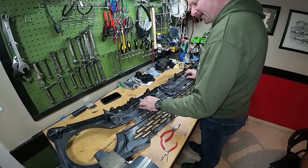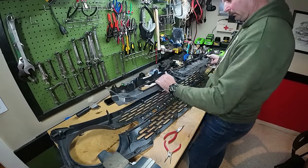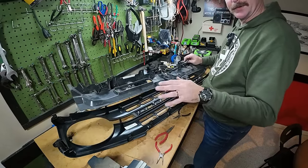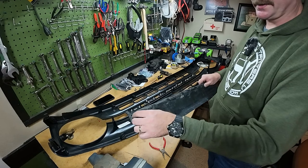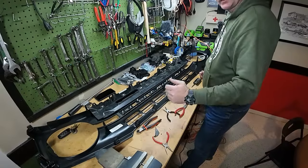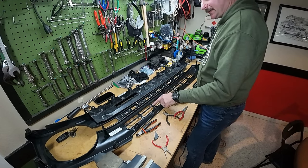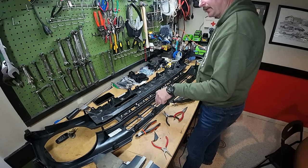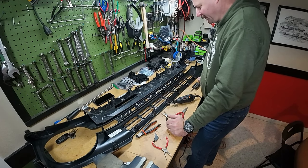The next piece I need to remove is this piece here, because I need these holes to be able to mount the grill to the Bronco. I'm going to take all these hoses off because they're all for the front camera and I've already relocated everything for the camera. To fit this onto there, I'm going to have to cut these ends off right here, so I'll get a Dremel out and cut these, then drop it right on. We went ahead and Dremeled off those ears and bolted it back on. If you ordered one of these new grills, I would definitely order a new piece like this that's meant for the grill — that way you can avoid any cutting.